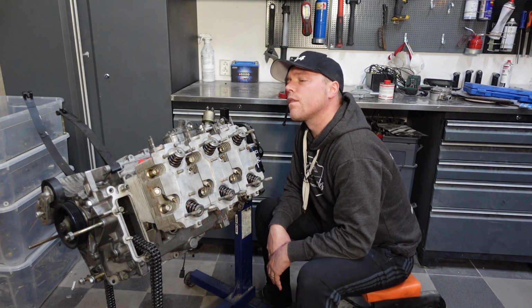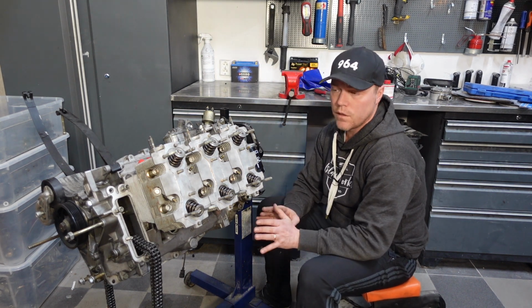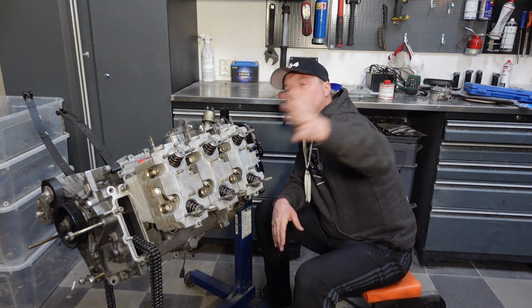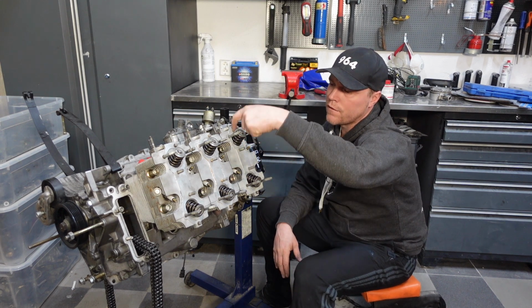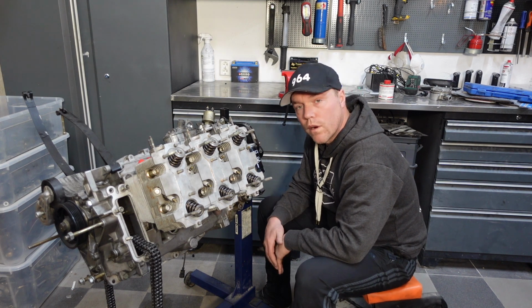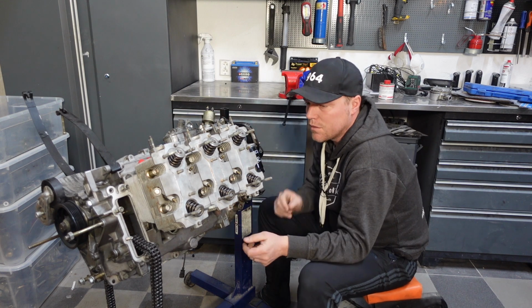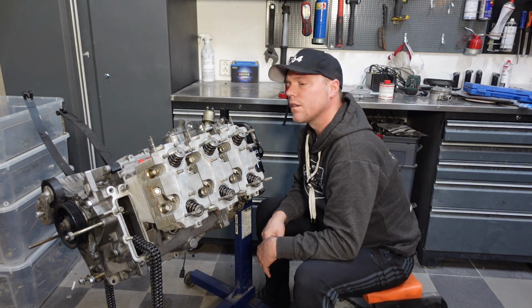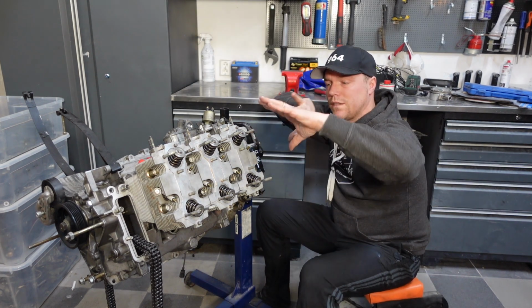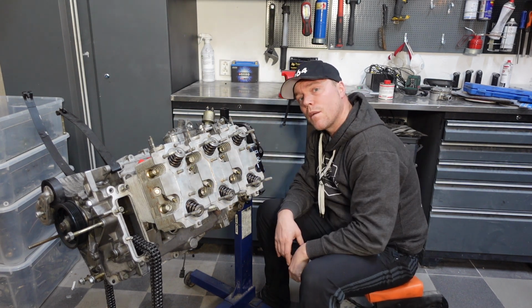Okay, so all the 3 cylinder heads are just seated there. I didn't use any torque at all to put them down there. Now that the cam tower comes here, I need to seal off here. I need to seal that off nicely before I move ahead. And if any one of these needs to just move a little bit, then that's not going to be an issue. They still can, because I've only seated them, and once all of this is tightened together, then I'm going to torque these, right? Let's go look at the cam towers.